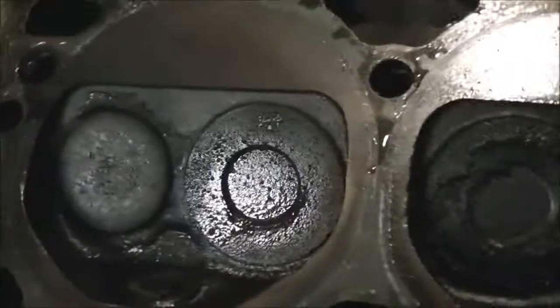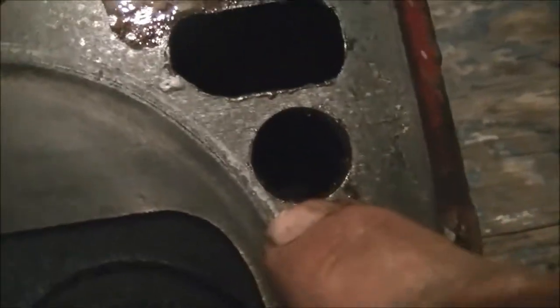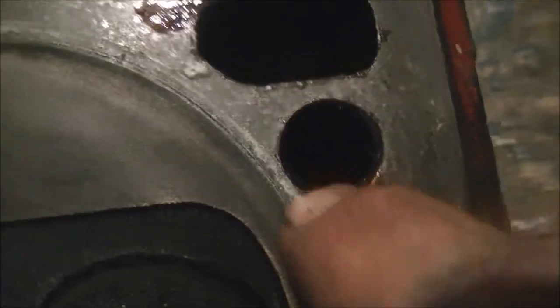That plug doesn't stick in there quite as far as the rest of them. There's one cylinder head. She is not a happy engine. You'll notice these head gaskets he was using are so big, they're almost protruding - with the sealing compression ring going into the water jackets. It might even be in the water jacket. That's going across part of the water jacket, they're so big.